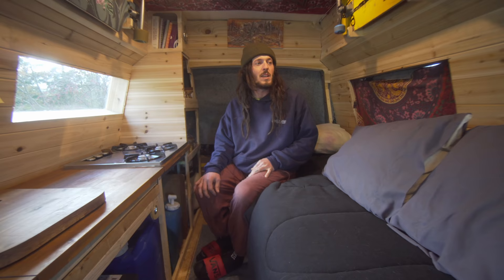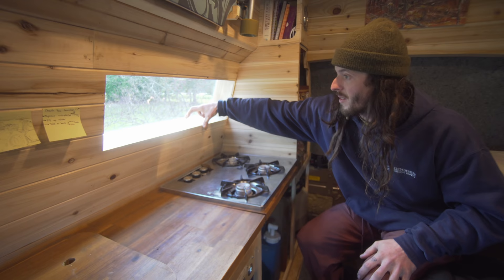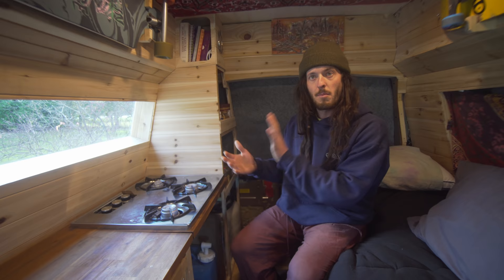It was a must to be insulated. I wanted this vehicle to be a four-season vehicle without worrying about being too cold. So I did R14 on the roof and walls, and it's four inches thick. On the window here you can see I did a framing and added insulating batts. I didn't put vapor barrier or anything — just trusted that things were going to roll out and not mold. R14 rockwool insulation is what I ended up using.